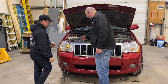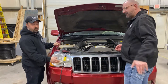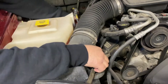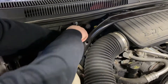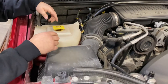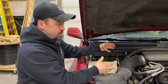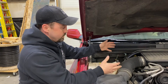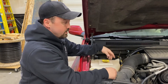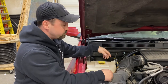So there's a cord here — this is mostly what people see when they plug in the vehicle. But where does it go? It goes right into the motor. Unfortunately on this one we can't really see it very well because it goes all the way to the back of the motor. It's basically a heating element attached to the side of the block, and it just heats up the oil so that it gets everything circulating, heats up the coolant, lubricates all the parts, and transfers heat into the cab.